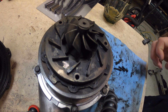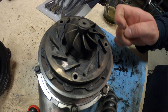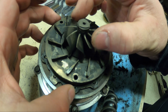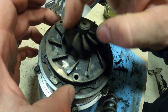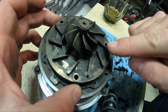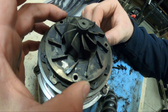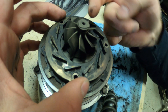Last time I had thought falsely that this direction is less boost and this is more boost — it's actually the opposite. This is how it enjoys life; make sure it doesn't touch. When the vanes are open like this, your exhaust gases go straight into the fan and straight out the top — not ideal. When you have the vanes close and the actuator moves, your air is more directed as it comes out, so you get more boost and more spinning.